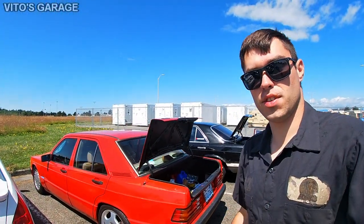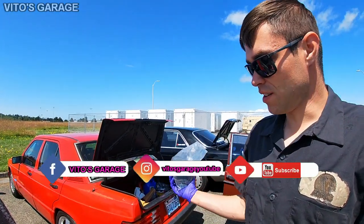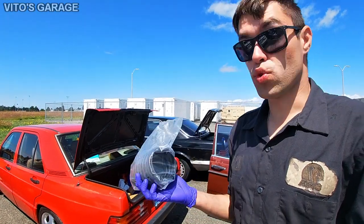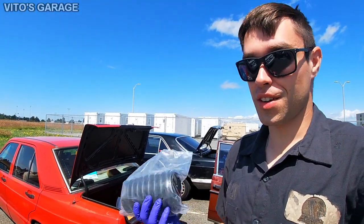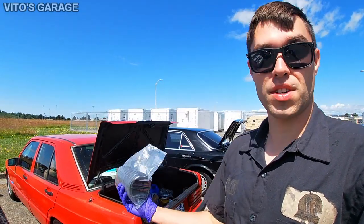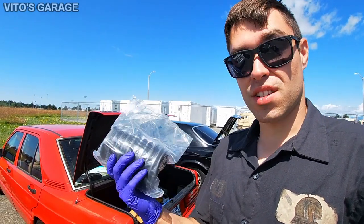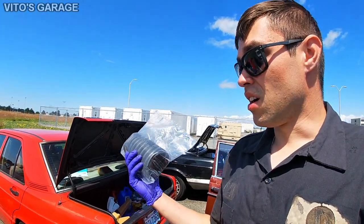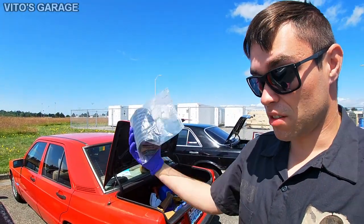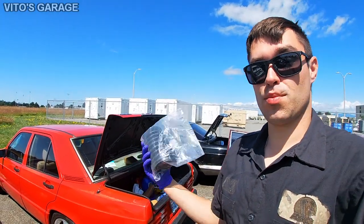What's up, guys? In this video, we're replacing the front shock absorber boots on this car. And the job is actually not so easy, but it's really important that you make sure you have the strut or shock absorber boots on your shock absorbers or struts, because this prevents all the dirt and debris from falling down in there. And as you know, a shock absorber has a shaft that moves up and down, and if there's any debris or junk in there, it's actually going to cause premature wear.